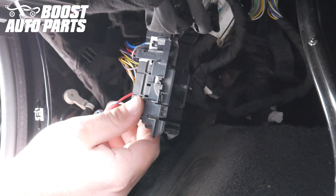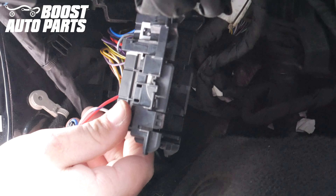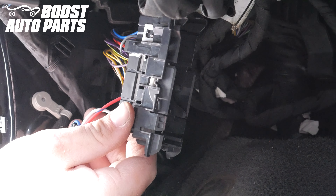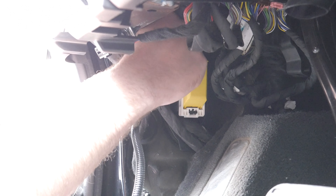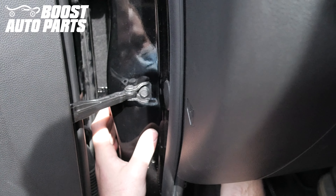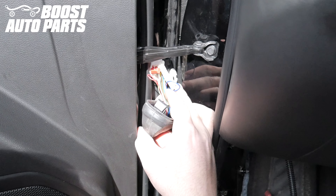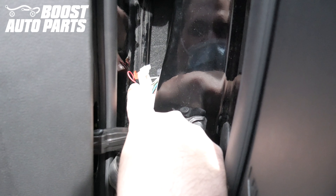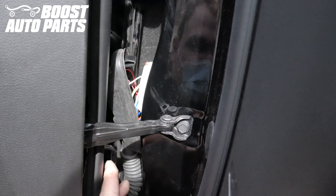Next, we're going to be reinstalling the door jamb connector. This can be a little bit tricky to get clipped in — it's very important that you fish it in the correct vertical orientation. You can see there are latches down at the bottom; those need to face down because the way this connector interfaces with the door, you first latch the bottom, then slide it up and it will latch into the top. Position the connector back into place, reach to the other side of the door and guide it into position. Once latched at the back, use your hand from the back and slide it up into position — it will lock straight in. Guide the door harness back into position. Once lined up, slide the black connector all the way in, then slide the white latch forward. Once fully engaged, slide the red lock towards the inner part of the vehicle. For the rubber boot covering the door jamb connector, begin by latching it at the bottom, then slide it straight up and it will engage into place.